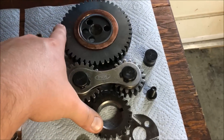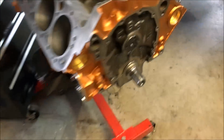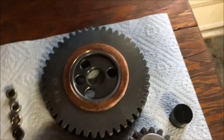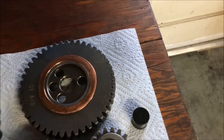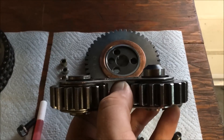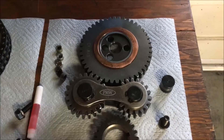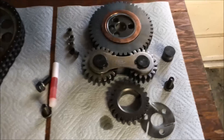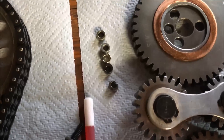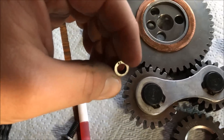You have your cam and crank gear, which are these two here. This brass bushing goes to the backside right here on the block — that's the bearing you put towards the back to keep from wearing this surface out, and the same with the block. Basically you have your idler gears, which one has a nipple that sticks out a little bit farther — that goes to the back. Your bigger gear goes to the left. What I like about these is they're pretty quick to adjust. Most of these kits for the Chevy and the Mopar come with these adjustable cam locks so you can adjust your timing degrees.